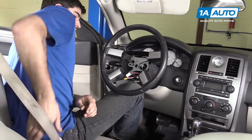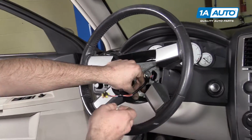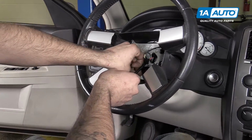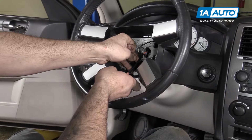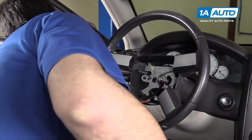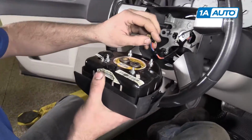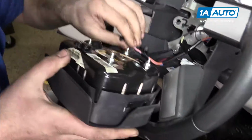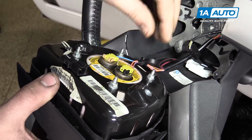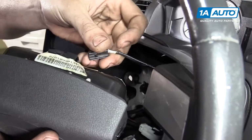Remove the seatbelt from the wheel. Reconnect the white electrical connector at the bottom rear of the inner steering wheel cover. Touch some metal components of the vehicle to make sure that there is no static charge on your body. And reconnect your airbag connectors. Snap that retainer back over the stud. And reconnect the horn.